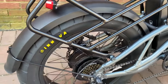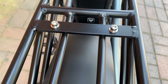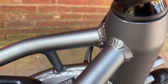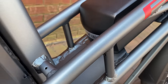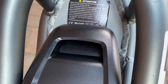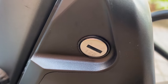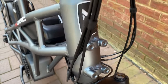Wrapping all of this is a plastic fender that matches the front fender, and the included rear rack — pannier-friendly with top mount points. Robust is the word that comes to mind, and the specs back that up: a max payload rating of 110 pounds, and it's also the mount point for the bike's taillight. The bike's overall max payload is also impressive — 400 pounds — thanks to the power output and the strong tubing of the 6061 aluminum frame, color: titanium. As you can see, because there's nowhere to hide them, this is a dual battery e-bike — 48 volts and 10.4 amp hours each, load balanced, equaling 20.8 amp hours, that's 998.4 watt hours of power. On paper this gives a stated range of 40 to 55 miles throttle only, 60 to 80 miles in pedal assist. Even with the exposed frame design, all the wires are well hidden, the few visible ones cleanly routed. Water resistance rating: IPX5.